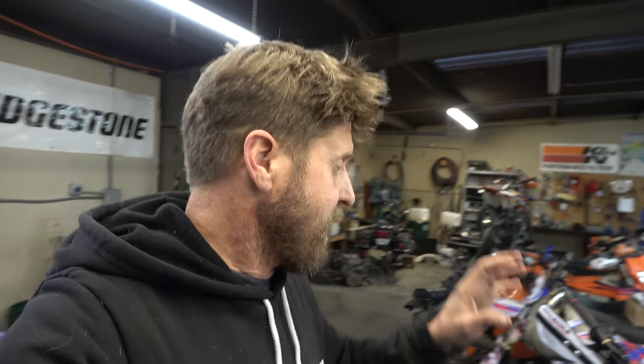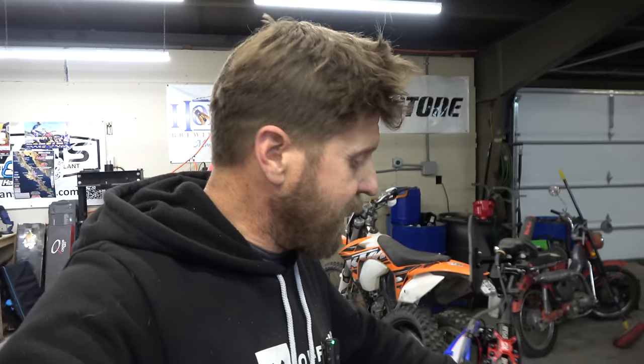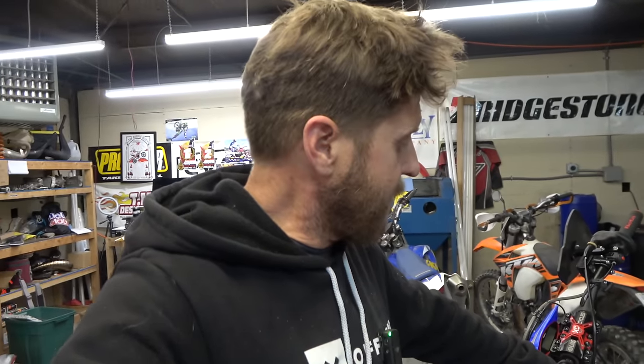All right, guys, the bike is running perfectly. That jetting seems to be right on the money. It's a 40 pilot, 158 main, NECJ needle in the number two position. I live at about 5,700 feet. Everything is up from here, so that should be really good for a lot of places.